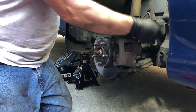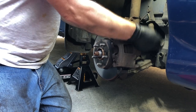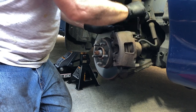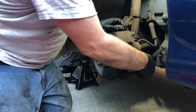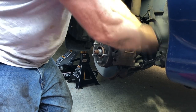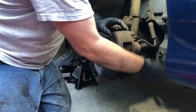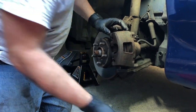We can tell right away when we try to take these slide pins out, they're really, really stiff coming out. What usually causes this kind of uneven wear is because they're binding inside the sleeve or bushing inside this particular design. This caliper is supposed to float on the rotor, and if you have it binding up, then you'll have that problem.